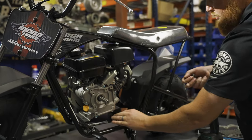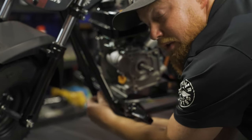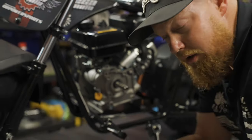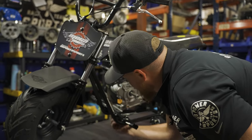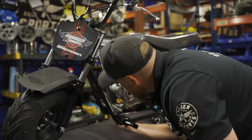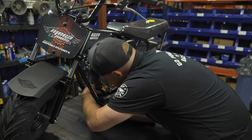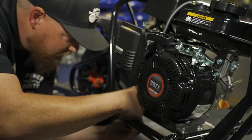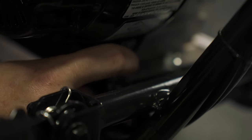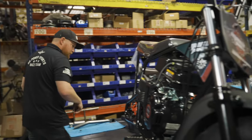Now we've got our four adapter plate-to-engine mount bolts. One other thing that kind of gets in the way — take off that stock engine tension bolt. Now we've got room for everything from this kit. Snug all these up by hand as well. This looks good, so I'm going to go ahead and tighten up the engine all the way forward, and I need a 10mm wrench.